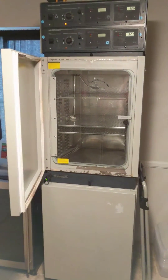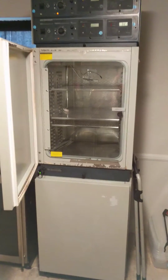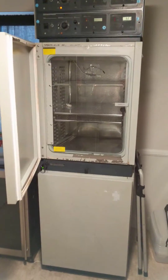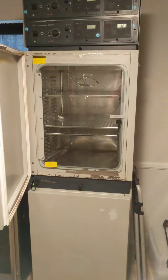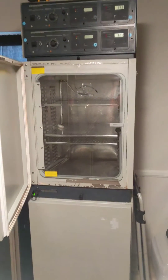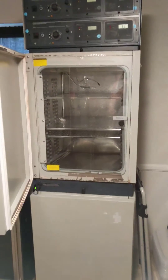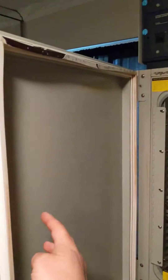What's also awesome is when you open the door to check on your eggs — which you usually don't need to do — you shut the door and there's enough heat stored in the water-jacketed walls that it heats up the chamber fairly quickly. There's much less temperature drop, and that whole reheat cycle gets minimized, which is very cool.